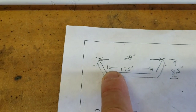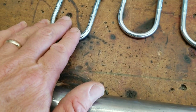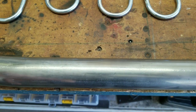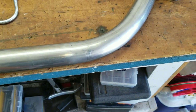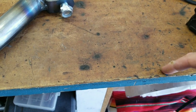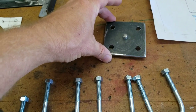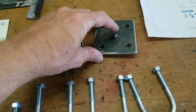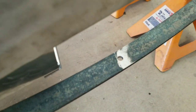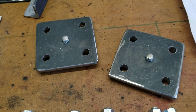For the spring mounts, we're 17.5 inches before the bends start — there's a mark right here. The U-bolts will accommodate a bend slightly before that mark, so not a big deal, but you have to have enough space for your frame to fit in before the bends kick in. We're roughly 8 inches from the kingpin to the bottom where the flat part is. I manufactured these to fit, and this little bolt welded in center of the spring is basically just a locator pin that keeps your axle from sliding back and forth on the fitment.